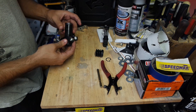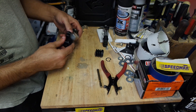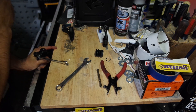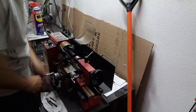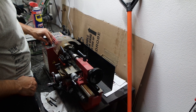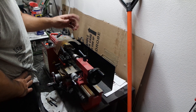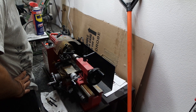The way my lathe clamps, it's not going to clamp very easily onto this. We'll want to take off our fittings so they're not spinning — especially the banjo bolt, which is really going to cause it to spin off-center. It's not a very big lathe and we don't want too much wobble. We may have to shave the outer bit down so it becomes centric, then flip it, machine the other side so it's perfectly centered, flip it again, line it back up, and then clear the bore. Got a lot of material to take off.